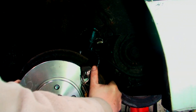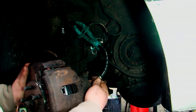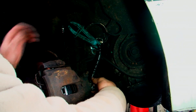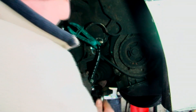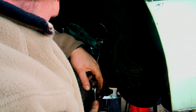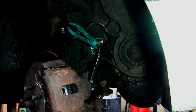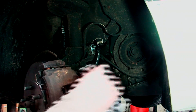As we can see we're not rubbing against anything. If you set this at different angles it can rub, so leave it where it can't rub anything. Use the 14mm spanner again, and be careful because like I said there's nothing in the middle — it'll snap very easily, but obviously you need it tight enough not to leak. Release the clip and screw in this bolt.